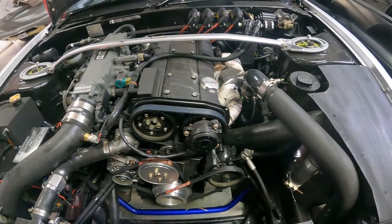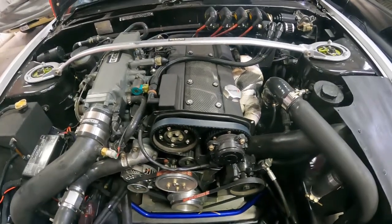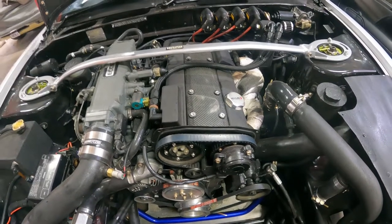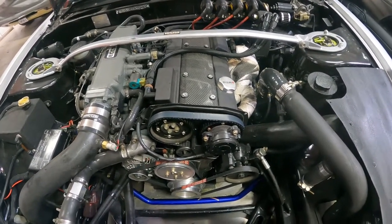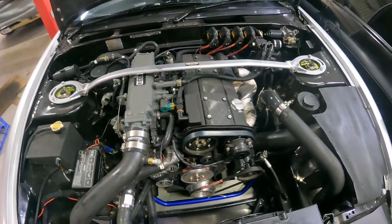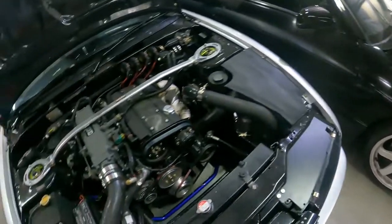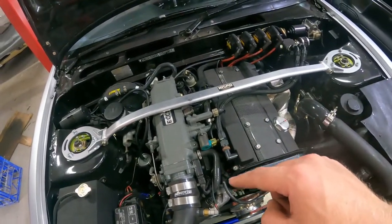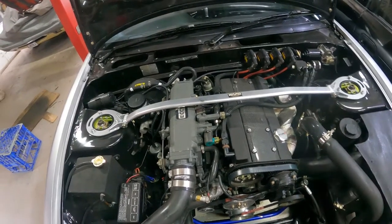So unlike the SR20, it's got a cast iron block instead of alloy. And this has lifter on cam instead of rocker arms, so it can rev out easier than the SR20. You don't have to risk popping rockers. But the head flow design's not quite as efficient as the SR20. And this actually also has butterfly valves for the inlet, and each cylinder has 2 inlets.